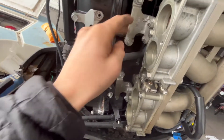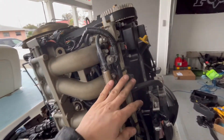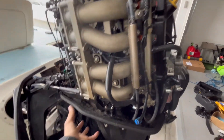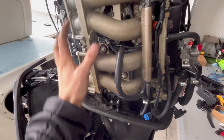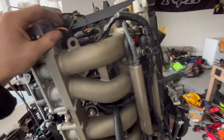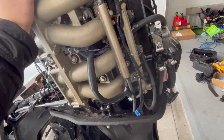I don't even know if you need to take these off — at least take these four off. Once that's off you can get to the VST. I had a bunch of clips of me taking off the fuel rail and stuff; I'm just going to delete those because you don't need to. You can actually have the manifold sit here on the cowling as long as it's supported, because you don't want it to fall and rip all the wires off.